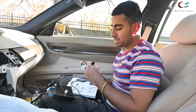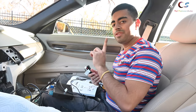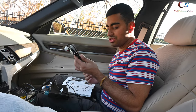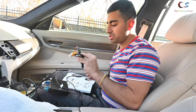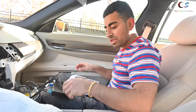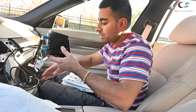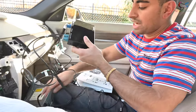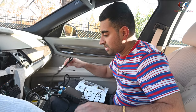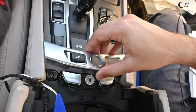I'm probably not going to connect the USB/camera connector because this car already has surround view and all the cameras, and we want a clean setup using wireless CarPlay. In the future I'm going to implement a wireless charging pad into this glove box, so we won't use the USB for charging. We're going to skip this connector. Next we need to remove this piece to get the cable — not only the AUX cable but also the cable to the iDrive controller. Let me show you how to tear this open.